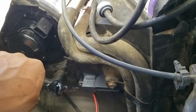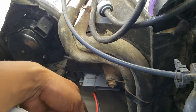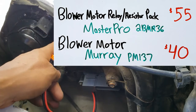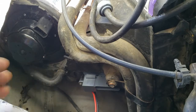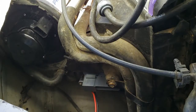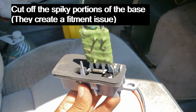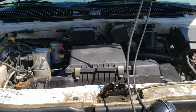The blower motor control unit has been changed. It uses two 5.5-millimeter bolts, or 7/32. A swivel ratchet is your best friend here. The control unit feeds the blower motor, so since this circuitry went bad it might have messed with the blower motor circuitry too, so I went and changed the blower motor as well. It uses the same millimeter bolts — five of them. This one has never been serviced so I had to cut the plastic molding with a knife. The plastic had deteriorated so badly that it crumbled on contact. This fixed our electrical issue — no more fuses blown.